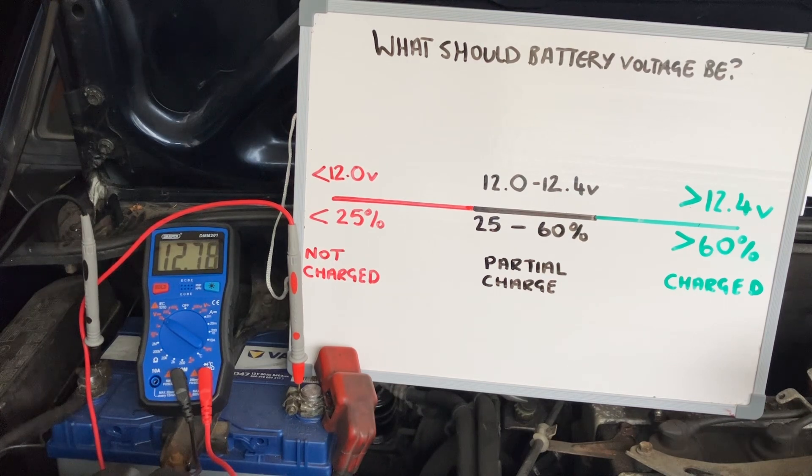If you're getting anything under 12.4 it is starting to degrade, and under 12 you'll be looking to replace the battery. Using vibrating trickle chargers can sometimes recover the battery and shake those crystals off the plates, but long term it's probably not a full solution. Once you get down to under 12 volts the battery may recover for a short time but most of the damage will be done. Keeping the battery voltage over 12.4 by regularly running it or using a trickle charger will give the battery the longest life possible — though over time it will always degrade, there's no way around that.